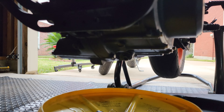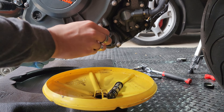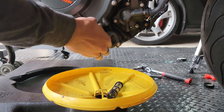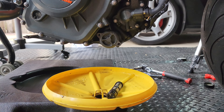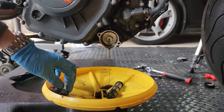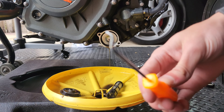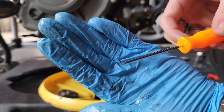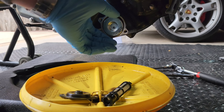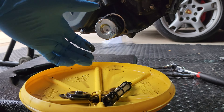Let's move over to the right-hand side and remove the oil filter. Removing the oil filter — super easy. Eight millimeter socket, put it on whatever wrench you want, and go ahead and remove these two 8mm bolts. Go ahead and remove the cap — you can clean this, and I'm definitely going to because it's disgustingly dirty. To remove the oil filter itself, you will need to use a little pick. It took me longer than I'd like to admit, but finally it's out — dirty, dirty.